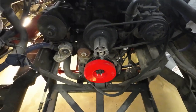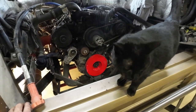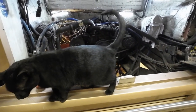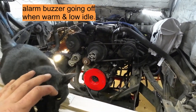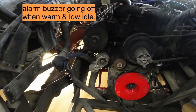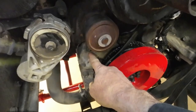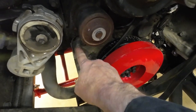I had some problems with the oil pressure buzzer going off. There are buzzers on these units that will come on if you've got low oil pressure, high coolant temperature, low coolant, or an alternator issue — and the same buzzer beeps for everything. I was having problems on the last trip with the oil pressure buzzer going off. In this housing here is the oil pump, so since I had the radiator out, that was a good time to change the oil pump.